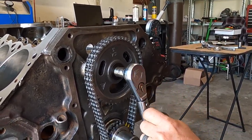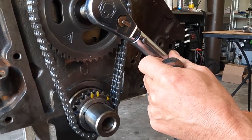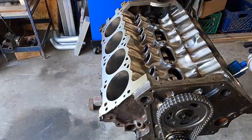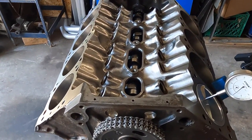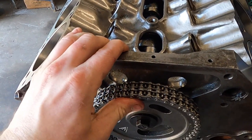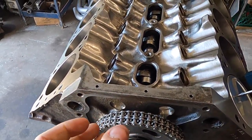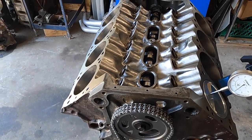Because we moved it, we need to roll it back and verify that our dots are still lined up. Always check after you've torqued it that your cam can still move forward and back just a bit, because sometimes the thrust plate will be too thick and when you tighten it up it'll lock everything down and you won't know until it ate everything.